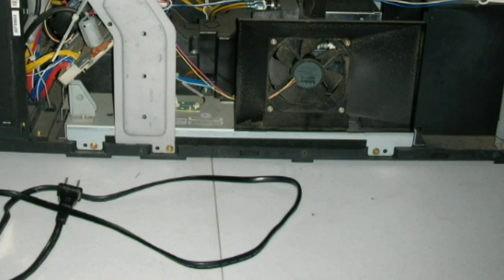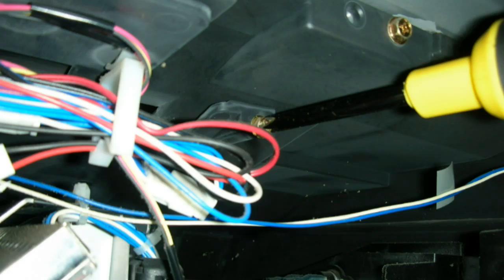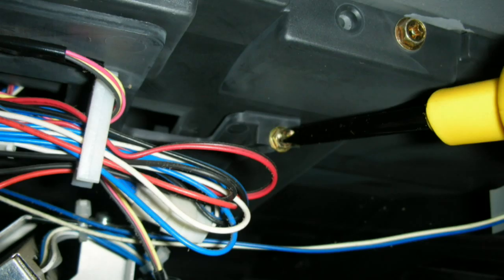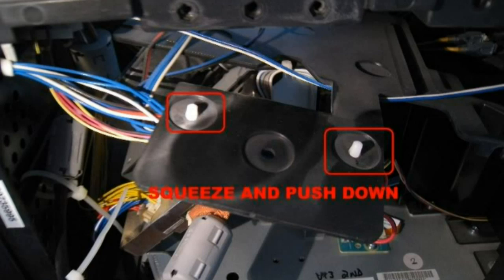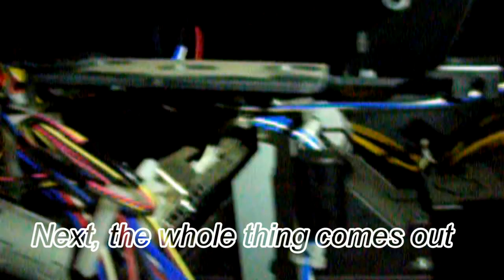Personally, I recommend cutting off that zip tie. Looking down a little bit, there's a hard-to-see screw just underneath, toward the top of the set — you want to undo that. That'll release a larger plastic piece that holds some of the cables in place. When you pull that, you'll see two little plastic clips — that's where your pliers come in handy — and you'll want to use those to undo the braces holding the cables down.